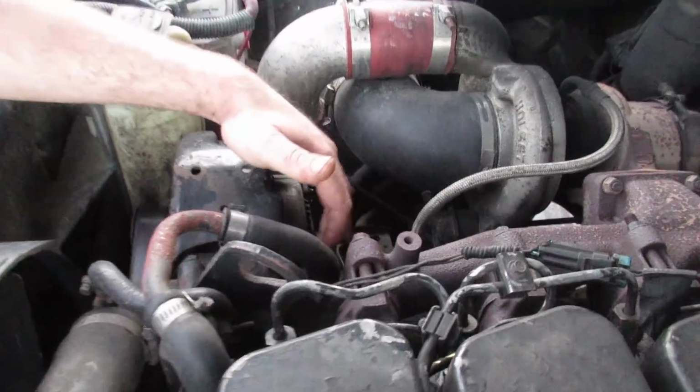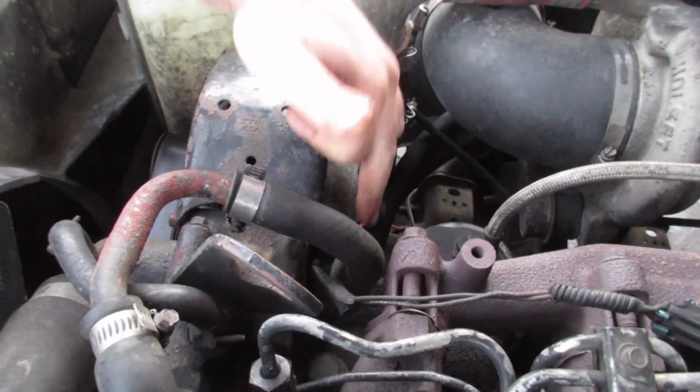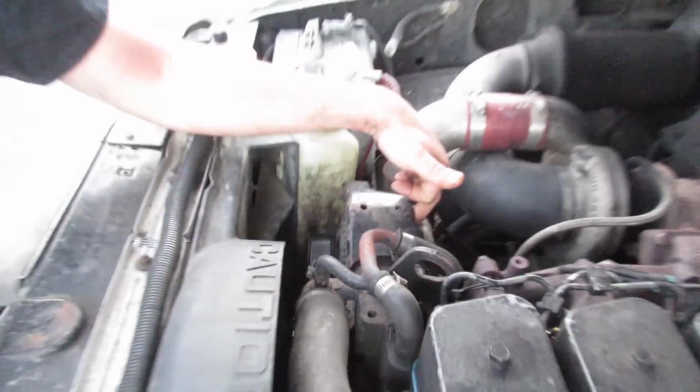Chevy NV3500. Okay, so then your speedo and everything. The speedo does not work. That's the only one that doesn't. So you've got tack? I have a tack running off the alternator. Yeah, off the alternator. This is a Dodge alternator. Tack wire onto one of the terminals in the alternator.